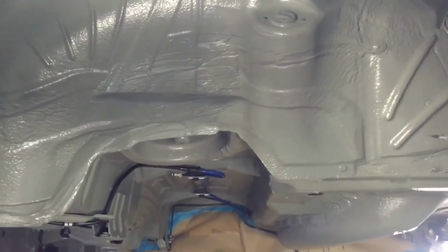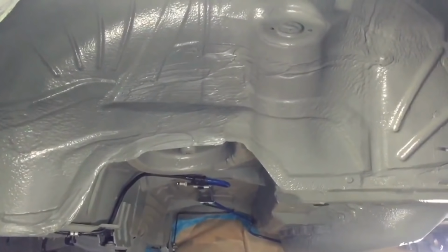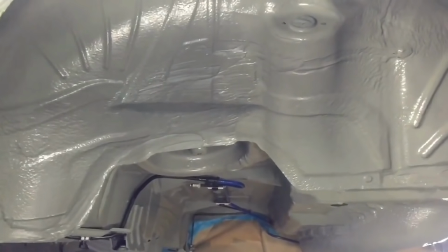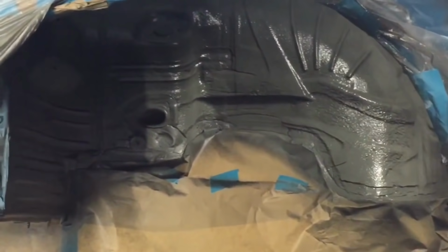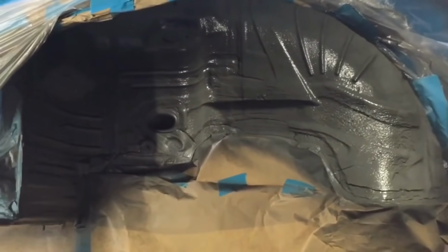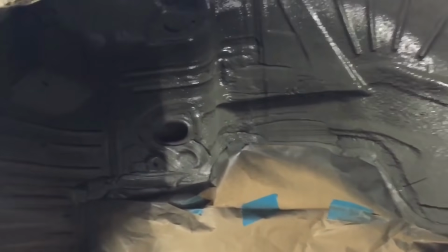So we're on the rear left arch now, just doing the OEM dusting of sapphire black. That's the factory colour, the E-coat that we've tried to replicate, and that's what it looks like. It's like an olivey green colour. That's it as it's gone on. And if I take you over to the other side, which has had the dusting of sapphire black, to try and replicate what the robot would be spraying on the side of the car, then that's what we've come up with. So we're quite pleased with it.